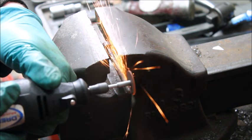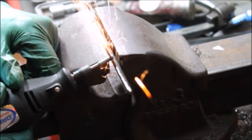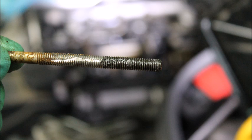Previously I mentioned creating a tool out of one of the bolts. All you need to do is cut a slot down the middle of the bolt using a Dremel or a hacksaw blade. You can then use this tool to clean out the holes that your new screws will go into to hold your injector clamps in place. Screw it all the way down into the hole and then back up again — the dirt and debris gets into the slot you've cut, so you clean it out and keep repeating the process until the screw comes out clean. This is really important because later you're going to be torquing a new bolt down, and if there's debris at the bottom the bolt won't reach its correct position, and debris in the threads will give a false torque reading. I used a Dremel for this — you can use a hacksaw, but it's quite tricky.